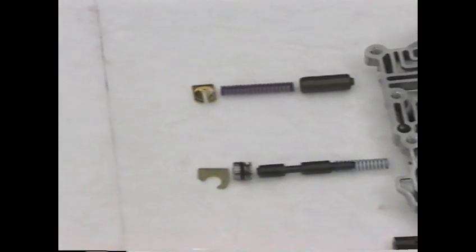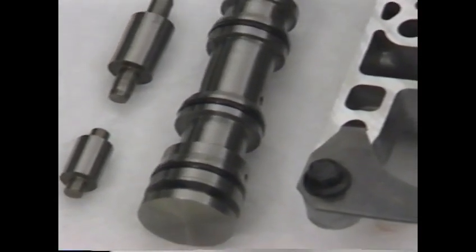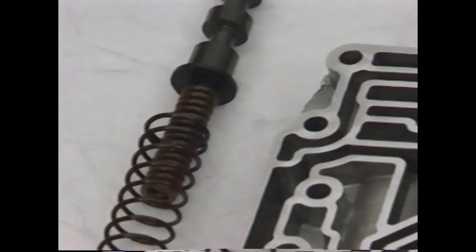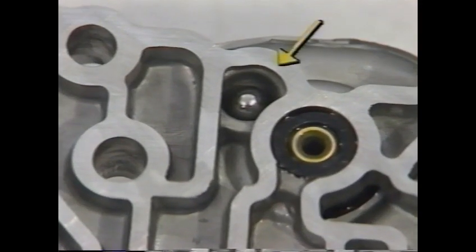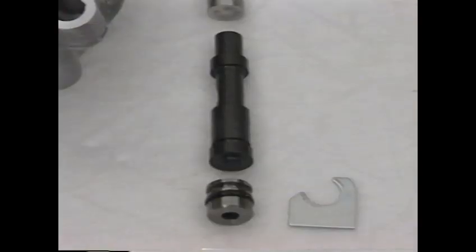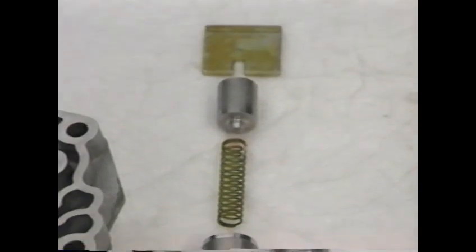While the lower body parts are probably all familiar to you, the upper portion of the valve body contains both similar and different parts when compared to conventional hydraulically controlled transaxles. Familiar areas of the upper valve body include the pressure regulator valve train, including the regulator valve itself, control and boost plungers, and necessary springs, bushings, and retainers, the detent arm and roller for the manual shaft, and a steel check ball on the underside. On the other hand, a unique new patented feature of this transaxle is the clutch priority valve, which acts as a hydraulic backup in case the electronic controls ever fail. The clutch priority valve train consists of a plug and retainer, a 3rd clutch exhaust valve, the clutch priority valve itself, and a spring and plunger.